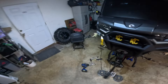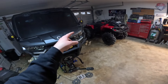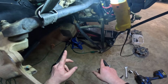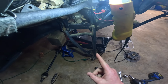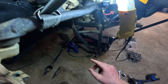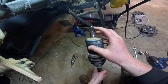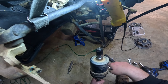We're back — sorry about that, I lost power and had to rebuild a generator. The only thing you guys missed was removing the shock. Once I got these arms up, I gave the axles a tug straight out — the straighter the better — and they'll pop right out of both sides. Sometimes this step can be a real pain in the ass, hopefully not the case for y'all. There's just a little C clip that's the only thing that really holds the axle in place — you just got to get it to squeeze enough to pop it out.